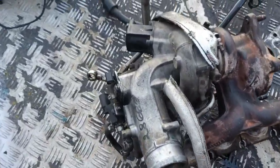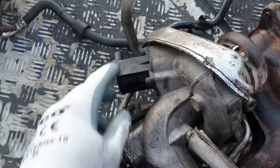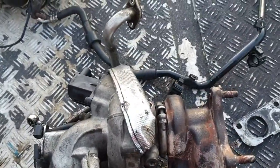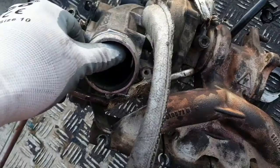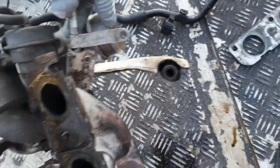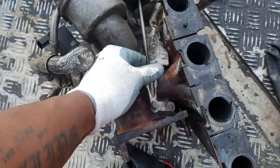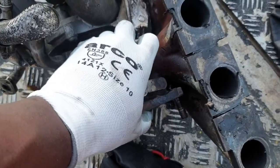Yeah, this is the K03 turbo. As you can see, it's got the, what do they call this again? Rev G DV. Is it diverter valve, isn't it? Yeah, that's a diverter valve. Yeah, this turbo develops a little bit of a wastegate rattle. So when I was coming off boost, you get a little rattle, which is really annoying. If you can hear that,